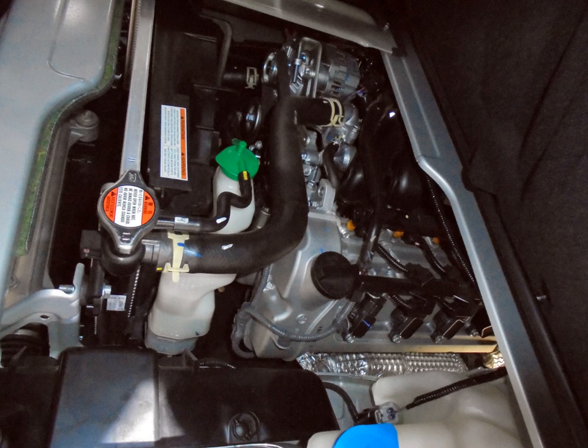F10A — displacement 1.0 L (59.2 cu in), 970 cc, 65.5 mm × 72 mm. Net power: 34 kW (46 hp) at 5,500 ±50 rpm. Max torque: 70 Nm (52 lb ft) at 3,000–4,000 rpm. 1979–1982 Suzuki SC100. 1982–1985 Suzuki Jimny 1000/SJ410/Samurai 1.0 (India — Maruti Gypsy, Pakistan — Suzuki Potohar). January 1983–2009 Suzuki Carry ST100. Indonesian market Carries received a fuel-injected engine for 2005 to meet Euro 2 standards, producing 60 PS (44 kW) at 5,500 rpm and 76 Nm of torque at 4,000 rpm.